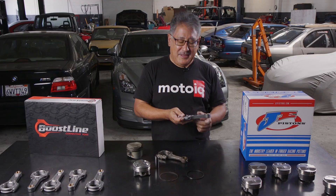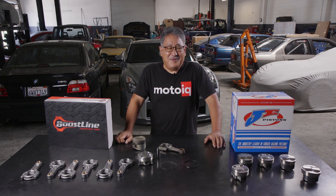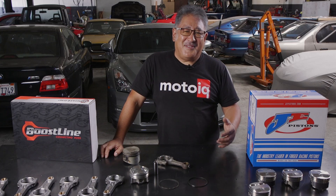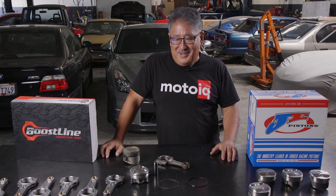Other tricks when building an RB: if you're building an older RB like off an R32, you really have to consider your oil pump because that's a real weak point of that engine. The drive flats on the crank are really narrow and there isn't much support, so you tend to break the oil pump gear. That can be solved by running an R33 or later crank. There are a number of heavy-duty pumps on the market, but on the R32 they're probably not strong enough. There are also spline-drive pumps that adapt the crank to use a spline drive, kind of like what you find on the 2JZ engine, and that is a pretty good fix. It doesn't hurt to do it on any of the RBs and we'll probably be doing that on this one in the future.